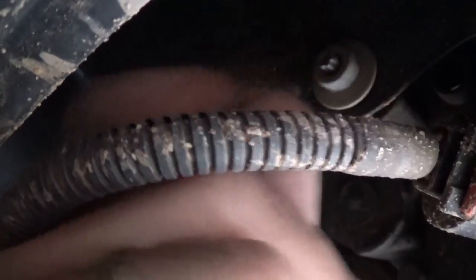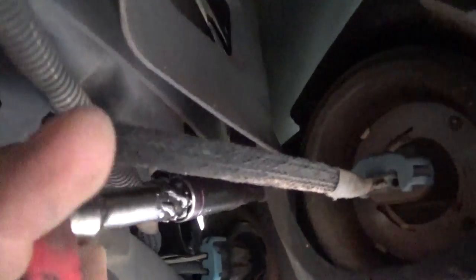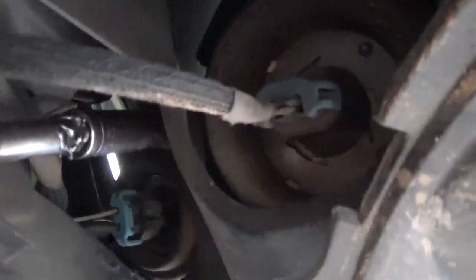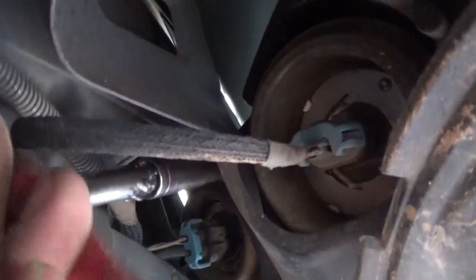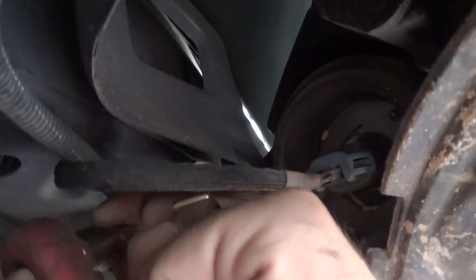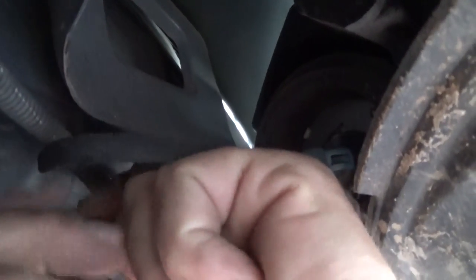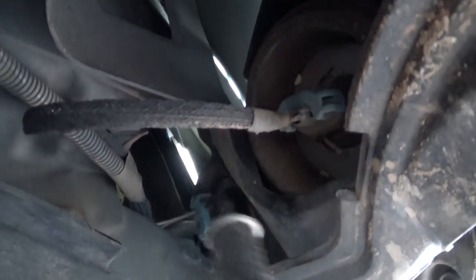Now right there we have one more — that's between the two bolts. This is the fourth nut, with a 10 millimeter socket and a little extension you can reach it. Be careful, but even if you drop it, it's going to fall on the underliner and you'll be able to catch it. Now this should be the last one holding the headlight.